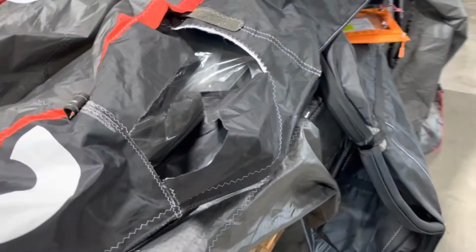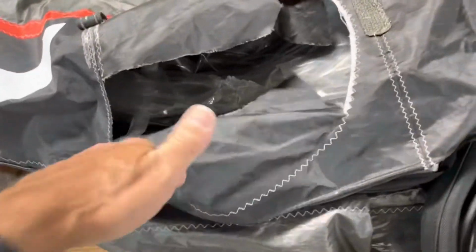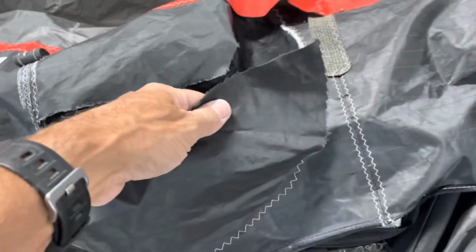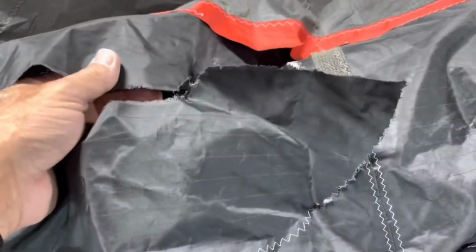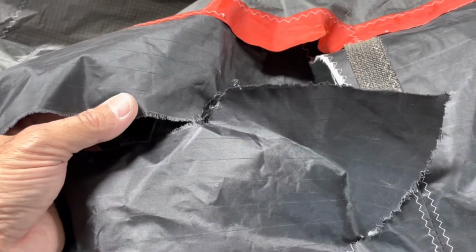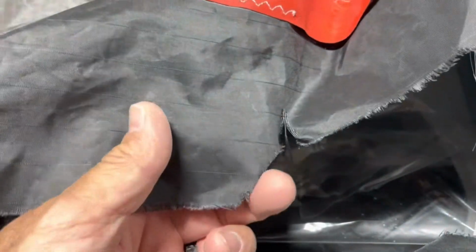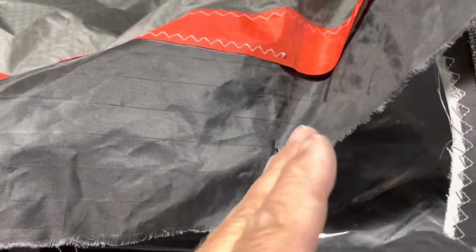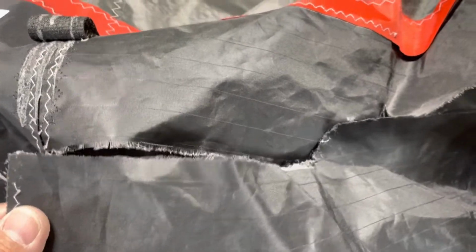All right, we get a repair in here. We start analyzing and taking apart so you can get in here to do the work. This one was caused by, if you're curious, a shell cut right there, or it got punctured by the foil, something. The reason it indicates that is it's diagonal across the bias. So it's this way, it's not straight. Anything else that's straight was ripped and blown out, and you can see why it's being shredded.